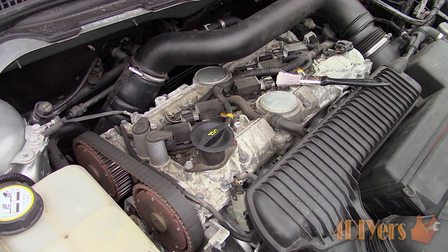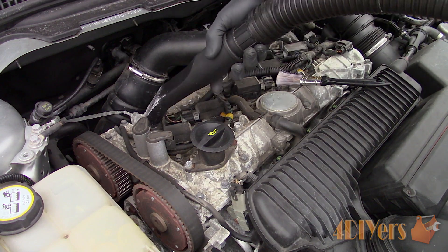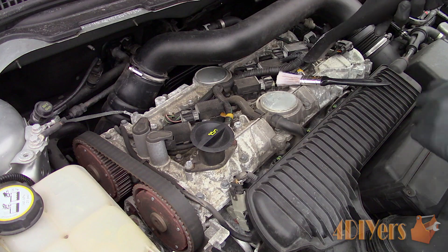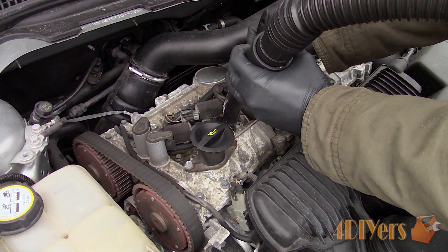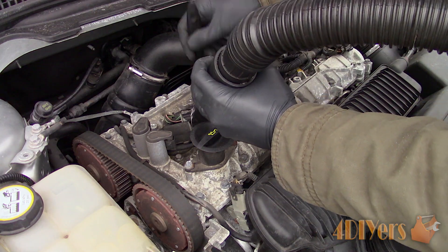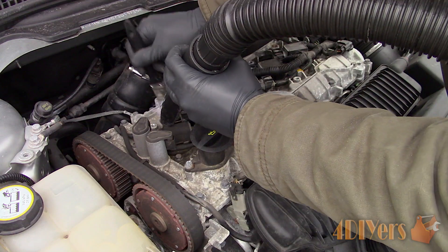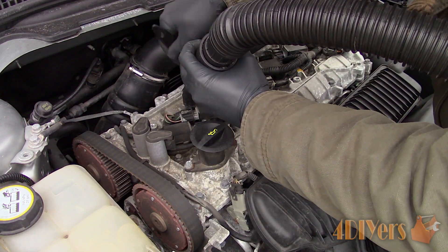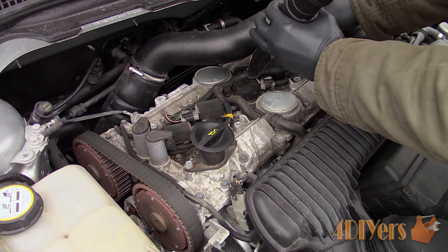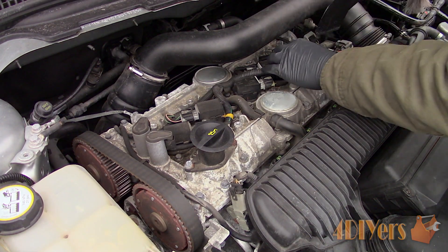I popped off the side cover as well to inspect the timing belt. When removing the plastic covers, now is a good opportunity to inspect the belt's condition — look for any cracking or missing pieces. If damage is found, a replacement is required. The plastic cover can trap debris, so use a brush to agitate the area and vacuum away any debris. Vacuuming up the debris will prevent it from falling into the combustion chamber when we remove the spark plugs.